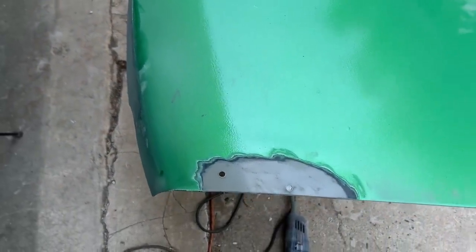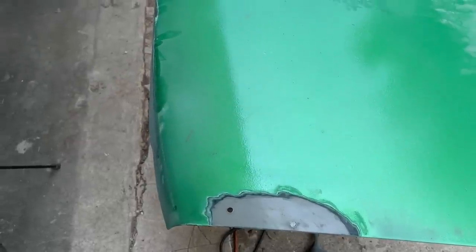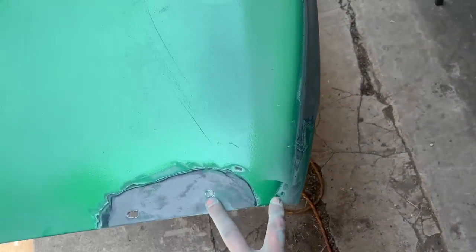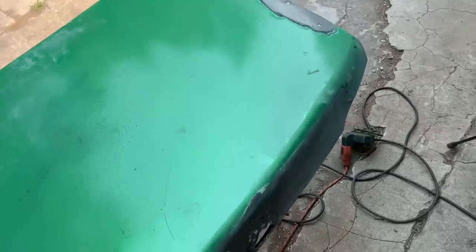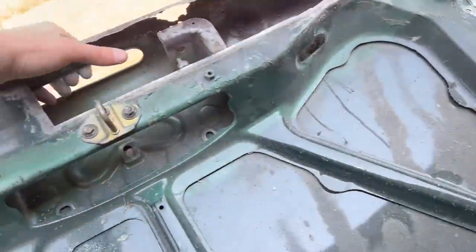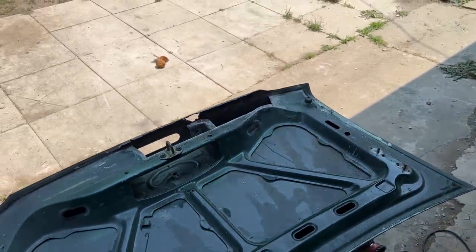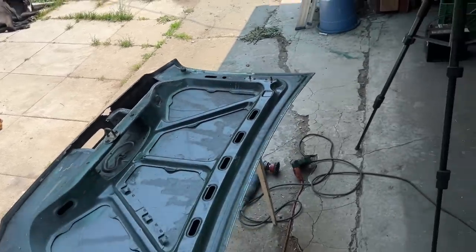More discoveries. Obviously somebody put a wing here at some point and then removed it - why weld it when you can just fill it up with body filler? It wasn't even parallel. You see this hole here to the edge is so much shorter than that hole there. Anyway, even more work. I removed all the body filler from here and I sprayed it with a rust converter - you can't see it here, it's too bright. We're going to give it some time to do its magic, then paint it and start welding the patch.